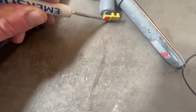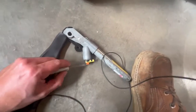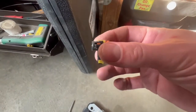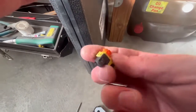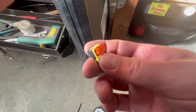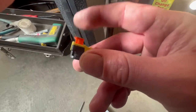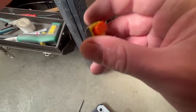These little connectors are pretty standard throughout the automotive industry — they're basically all the same type of connector. A note about this connector: this circuit will show open until this tab gets closed. How do I know that? Well, I did an airbag and a seat, put the whole seat back together, forgot to close this tab, went to clear codes, it wouldn't clear out — showing as an open. So make sure you close that tab.